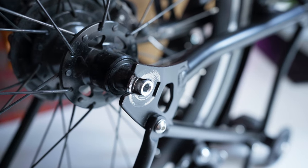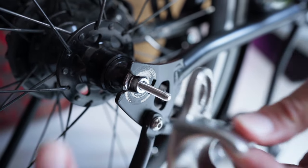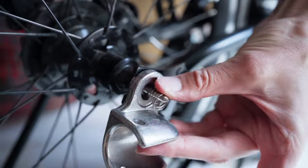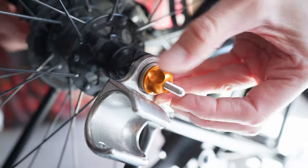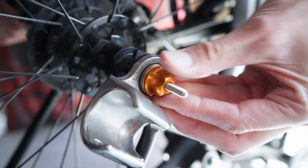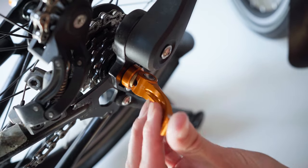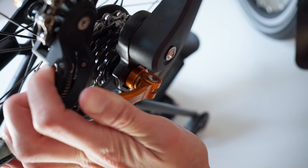It is simply a case of putting the skewer through, putting the adapter in place, and attaching the nut. As you can see the thread is still a little long but it is acceptable. The other great thing is I've now got a quick release skewer, so it's even quicker to change my puncture when I have one.